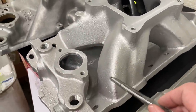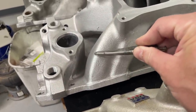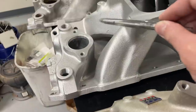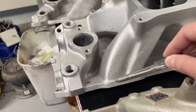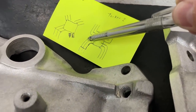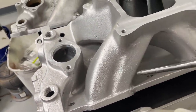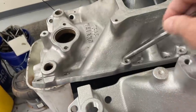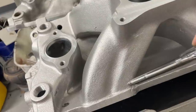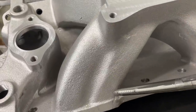Things moved on. This is a Holley Strip Dominator 300-R25 — really popular when I was younger. If you notice, the runners come in a little straighter and then start making the turn — more of a gradual curve. Darin Morgan often said he'd rather have one small curve instead of a large gigantic curve, and I agree with him. Having a 90-degree approach up high isn't ideal — having it more gradual like this is better. You can tell how things evolved. This one comes in a little more curved, and it's at a slight disadvantage because of the short distance to the head.